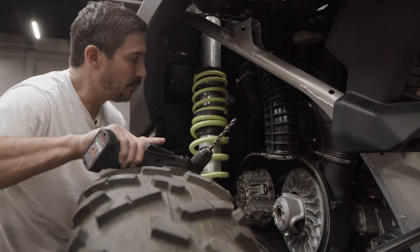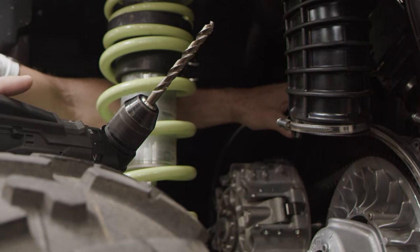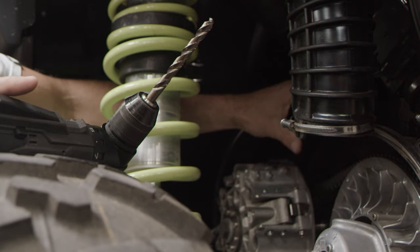When you're drilling the hole for your belt temp sensor, you're going to want to make sure the hole is directly over the center of the belt before you drill it out.